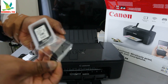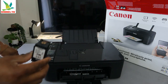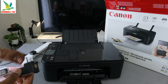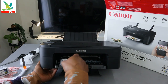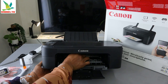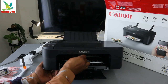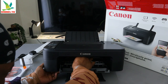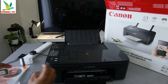You start with the black ink cartridge. Just pull off the plastic cover from the front of it where the ink goes. Be mindful of the chip in front of it. Looking at the sticker, the black cartridge goes to the right side. Insert it so that this end goes inside, then push it upwards — and it's in.